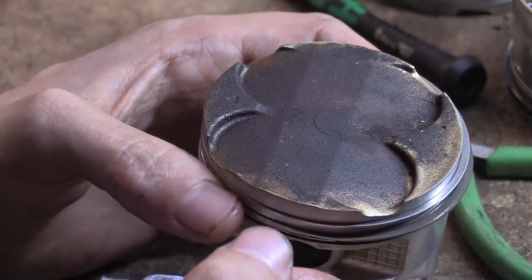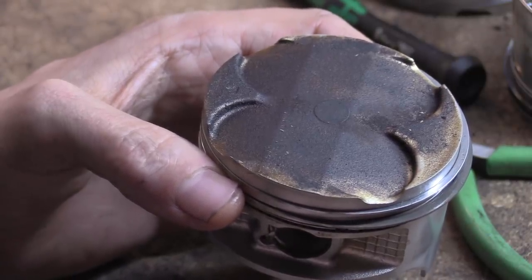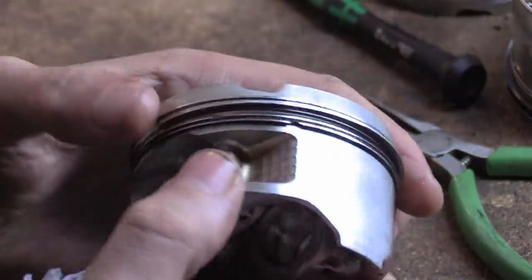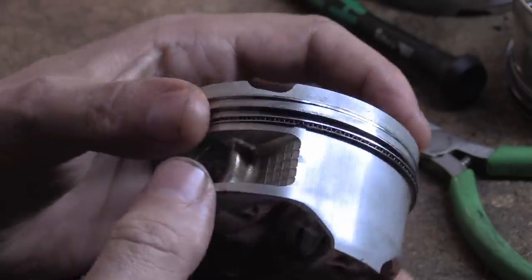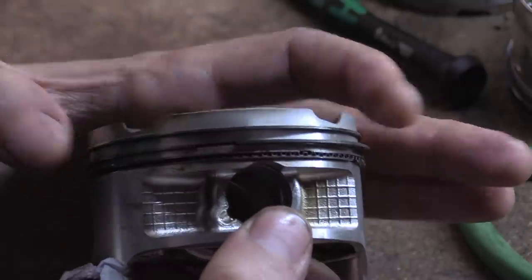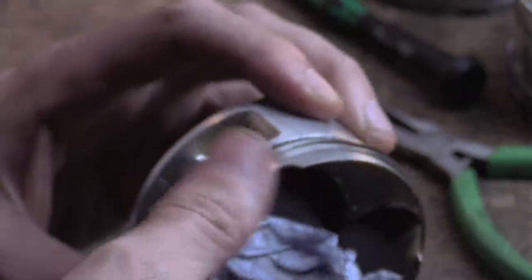The numbers are just for comparison and arbitrary in a sense — if I just said 26.364 to you, you'd ask versus what. That's why we measure across the skirt because of piston slap — this is where the pivotal point is. You could measure across the top, but unless you have the original spec or tolerance, it doesn't tell you much.